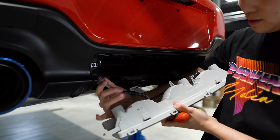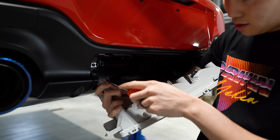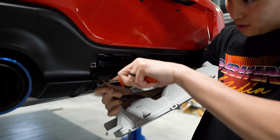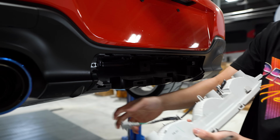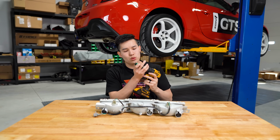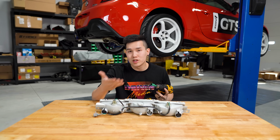And now, I can never do this with just my fingers, so I'm gonna use the flathead screwdriver to depress the connector, and hopefully it'll slide out. There we go. Now that this is removed from the car, we can take the included hole saw, install it into a drill, and that's gonna allow us to drill a hole into the underside where we install the light.